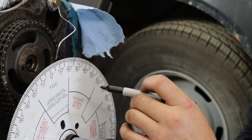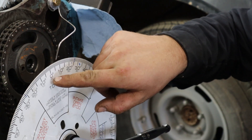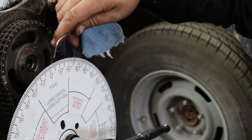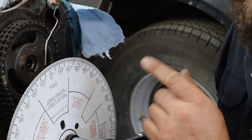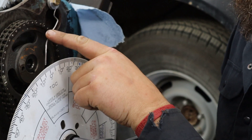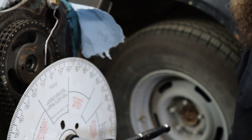So at this point here, what I'm going to do is take my little rod that I've screwed on and readjust it so it points at the zero point on the wheel. There we go. So from my point of view, this little pointer thing points perfectly at zero. So I know I'm at my top dead center.